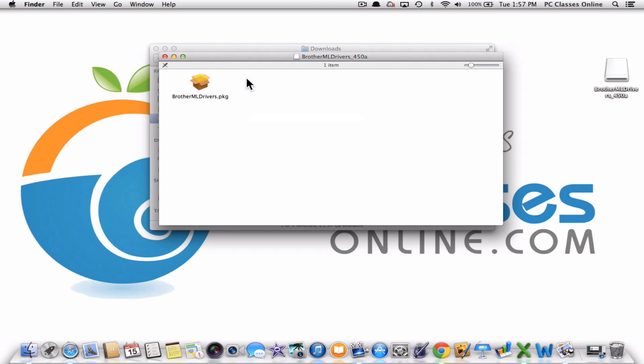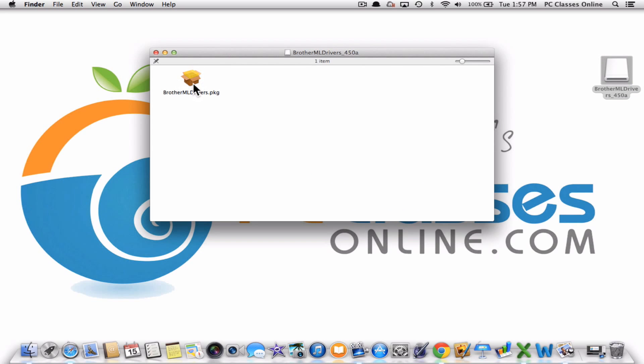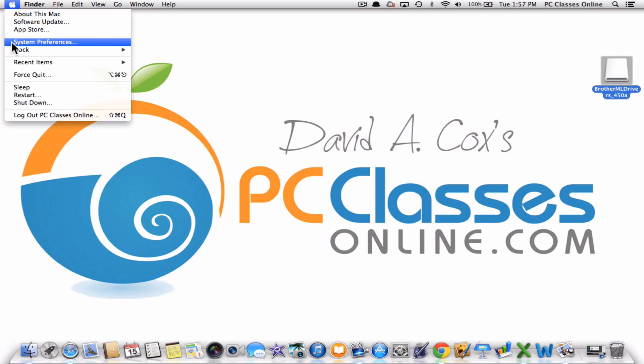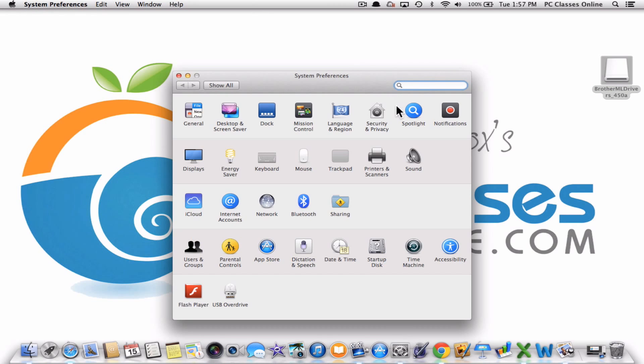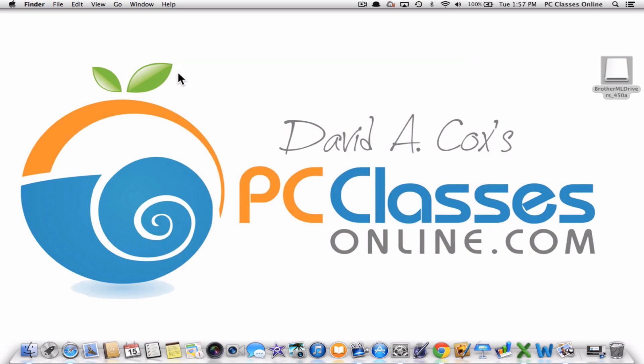When you install the driver that does not mean your printer is ready to go — there's still one more step. Windows users, it's going to be very similar, so I'll walk you through both options. Starting with Mac users: once you've installed that driver, just double-click on that icon and it's going to ask you a bunch of questions — mostly continue, yes, agree. When you're done, go to the Apple menu at the top left, go into System Preferences, go under Printers and Scanners, and simply click the little plus symbol — you'll see the printer listed right there. PC users, go into Control Panel, Printers, add a new printer, and it's the same process from there.